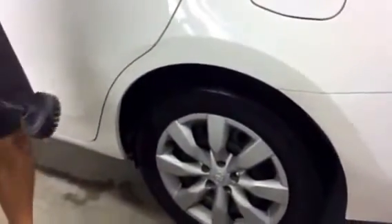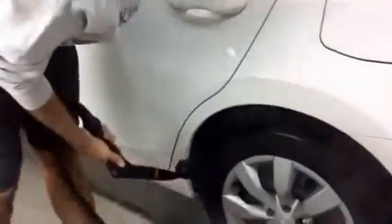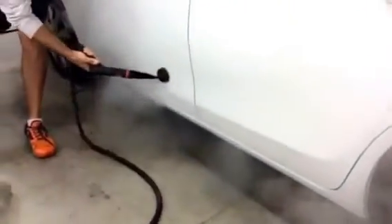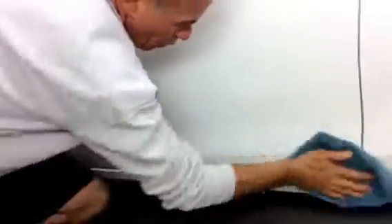I'm not going to do the wheels and tires. A little bit of injectable cleaner, then go back to steam. There's a bunch of road tar on the bottom — again, it's a white car, so we want to take care of as much of that as possible. The heat helps dissolve the road tar, and the cleaner as well helps dissolve it.